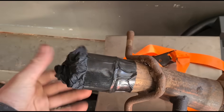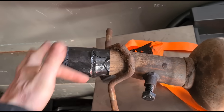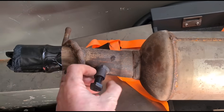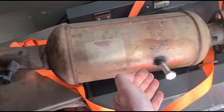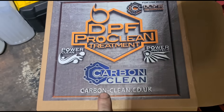The first thing I'm doing is putting a latex glove over one end just to seal it off, and putting some bolts that were supplied with the machine through these sensor holes. You don't have to remove the sensors — you can clean it with the sensors on — but this one has the sensors removed, so we're going to block up these holes with a couple of bolts.